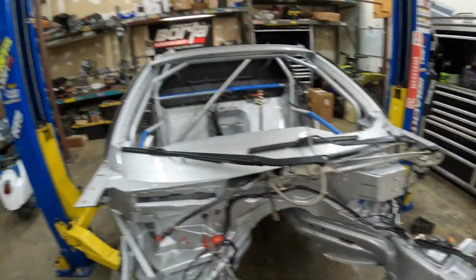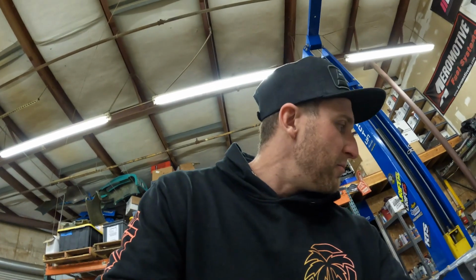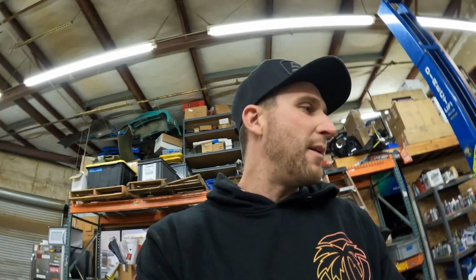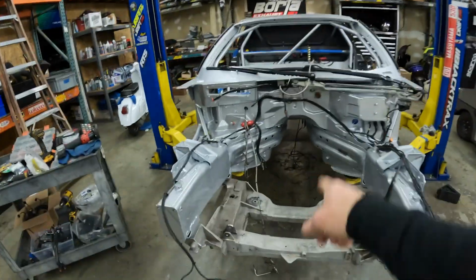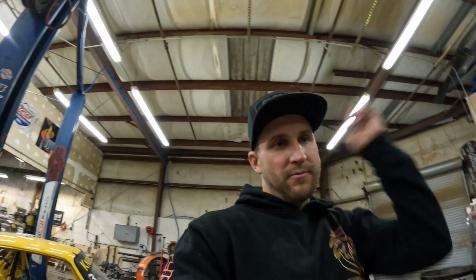I took the fuel pressure regulator off and put it over there because we need to rebuild that and the fuel system. I'll get to that pretty shortly. It needs a new diaphragm, new pumps and all of that. But I think I need to just stop doing wiring for a little bit. Gonna go underneath, put all the gold foil on the bottom of the trans tunnel, the temperature stuff, because then I can put the fuel lines in and then I can finish the wiring, which you see dangling, and clean up this giant mess of zip ties that I've just been adding to and adding to. So raise the car up, clean the mess, put some gold foil, and move on from there.